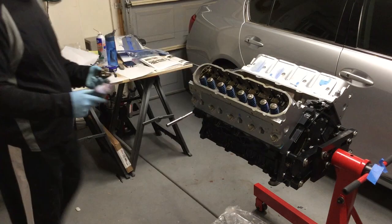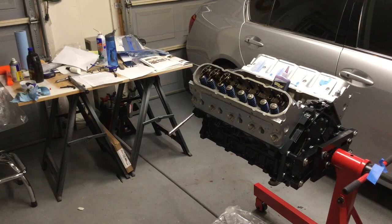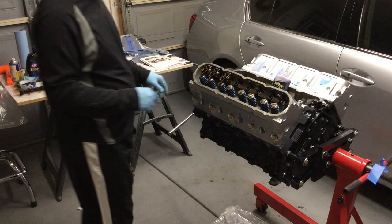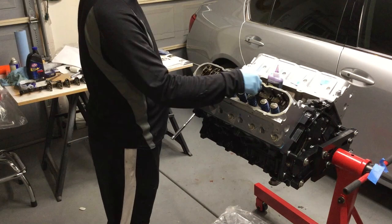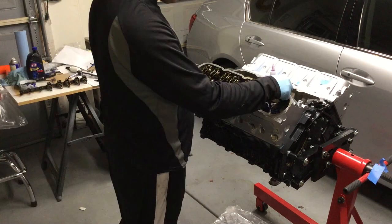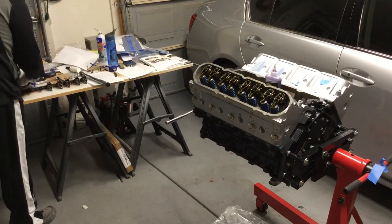There was a special sequence needed to properly get the right torque on the rockers, having the engine at a certain point where the valves were coming up a certain way. I don't remember exactly what it was, but it was very intricate — get it to top dead center, and then go an extra 30 degrees when you crank it. Just following that instruction and going straight through the whole process, doing each side. And instead of just oil, we're using a special engine assembly lube for the build.